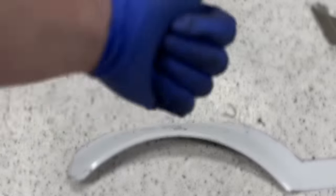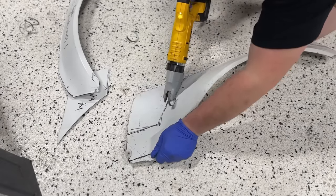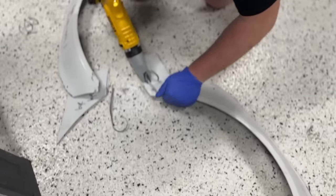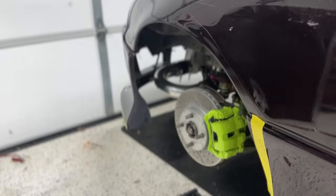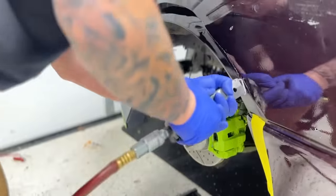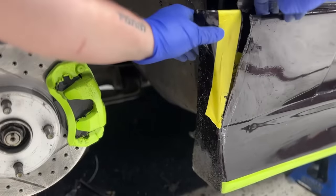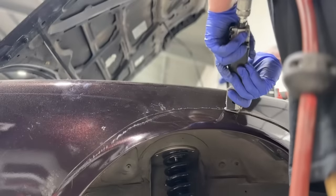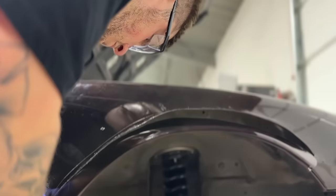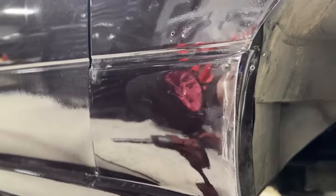The arches are the exact same, just wider. If I had to guess — I didn't really measure it — it's probably about 25 to 30 millimeters wider than OE. I just used a bunch of random tools around the shop. Keep in mind this car was wrecked and these are Chinese fenders. I cut the old fenders out, and also shortened the side skirts because binding will happen a lot with a lower offset wheel, even at a little bit more angle. I'm going to fiberglass and bodywork this to make it look better.